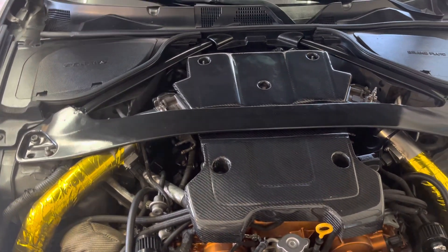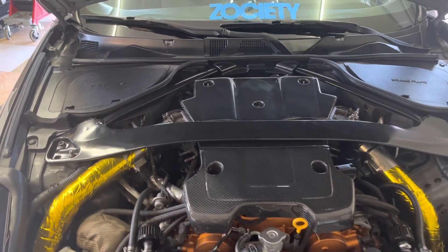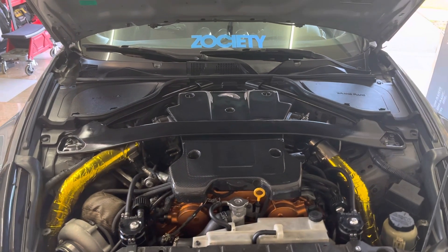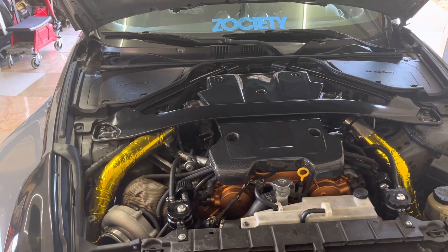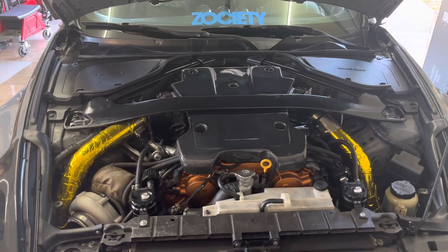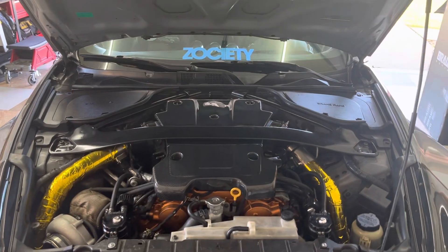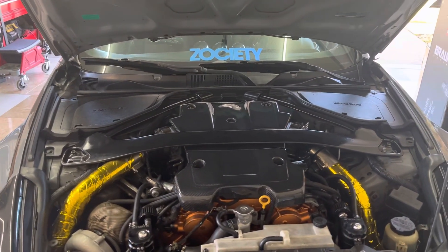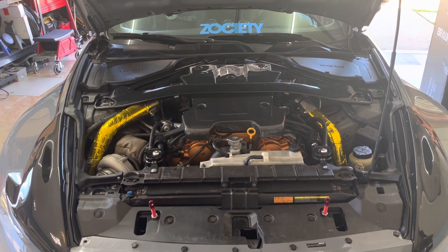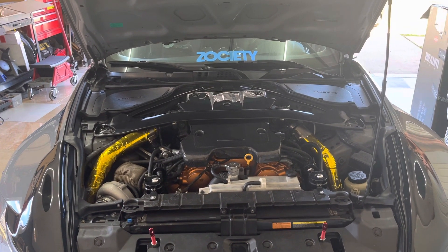When that fuel is getting pushed through to the engine and the injectors, that's obviously going to affect you. So I'm thinking of removing or replacing the fuel lines with hoses to come through the other side of the engine. I noticed that when I'm boosting at probably 12–13 pounds, sometimes you're going to hear the power cut off a little bit because your fuel might be too hot going into the injectors. That's where the return fuel line comes into play, which I'm still waiting for — it looks like CJM is behind on back orders on the S1E system, and I won't get it until maybe mid-April.